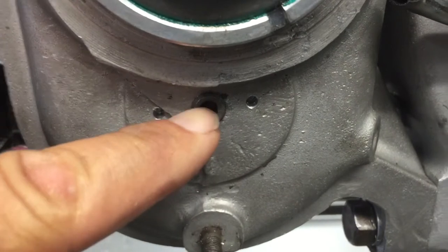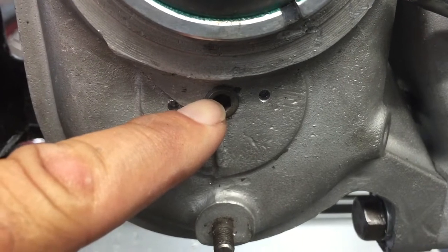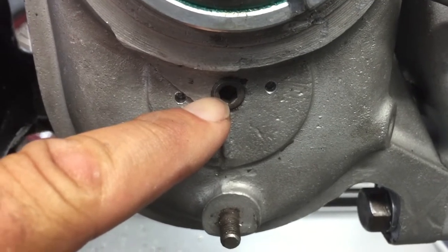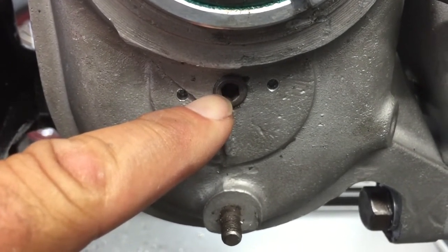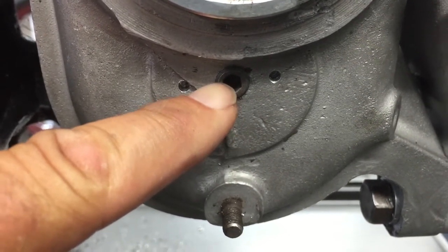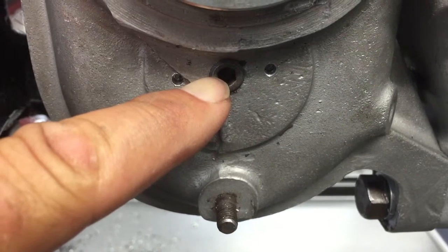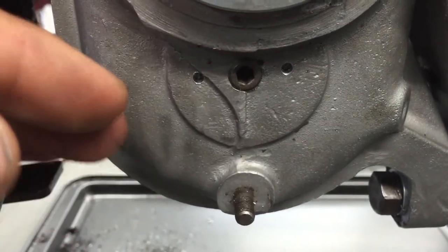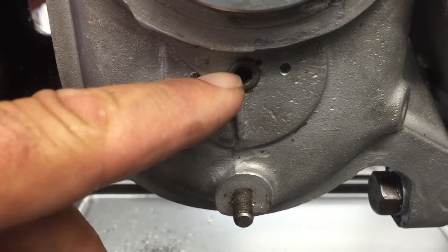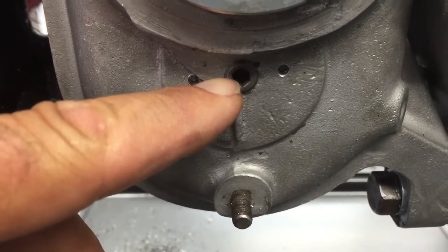The other thing is, Indian had a real poor sealing arrangement. Here is just a gasket that's set on the inside, and quite often this is a leak point. We put a plug in here — you don't have to drill anything, it's already got a big hole here. Just get a one-eighth inch pipe tap and tap this hole, then get your plug. You're going to have to go back and forth — check the depth — because you don't want this plug going too far in. It's just got to be flush with the inside of the trans case, otherwise it's going to push on the end of the countershaft, and that's bad.